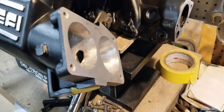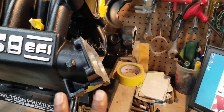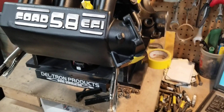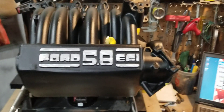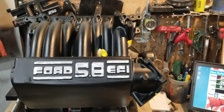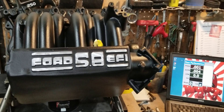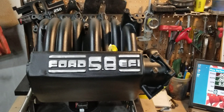So to get this manifold to flow 272–273 CFM without a radius — there's no radius here, so this sharp edge actually hurts flow a little by a couple of CFM — when you put an unrestricted throttle body, a nice unrestricted intake pipe and filter setup, it's going to flow a little more, usually about 5 or 6 more CFM. But for this manifold to flow 272–273 with our Stage 2 / Stage 3 porting — guys, that's more than an out-of-the-box carb Edelbrock RPM Air Gap, and you know what those can do on a healthy motor. That's more than a System Max 2 out of the box.